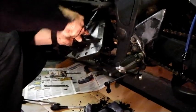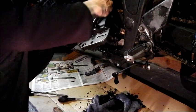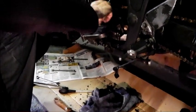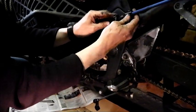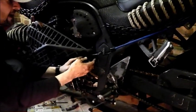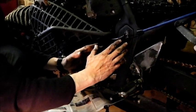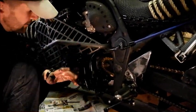Now here's a little trick: just take the hose off. When you're bleeding up any system, it pays not to have the hose empty if you can help it. If the hose is plumbed up like this one is, it's handy if you don't allow the hose itself to empty its fluid. So take the banjo off, preserve the two washers, and pop the casing out of the way. Then with a bungee, just get hold of that and bungee it out of the way. All that's done is put a kink in it, and that's stopping any fluid coming out. So that hose is now virtually all plumbed up - when I put it back together there's probably only a tiny amount of air in it, which is easy to just bleed through.